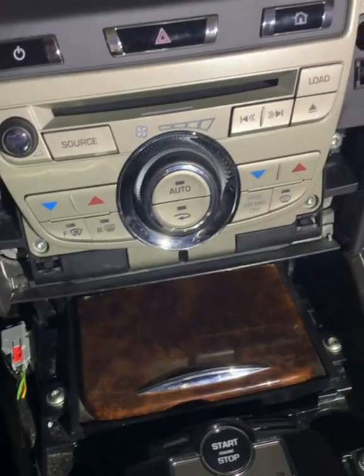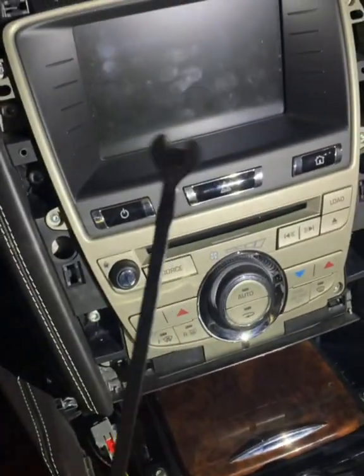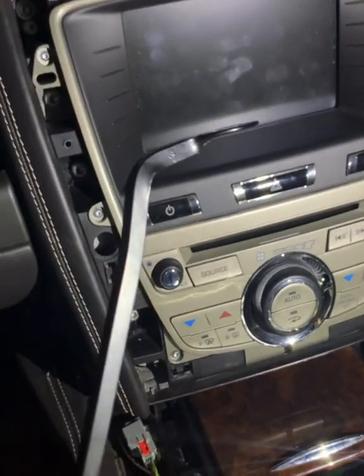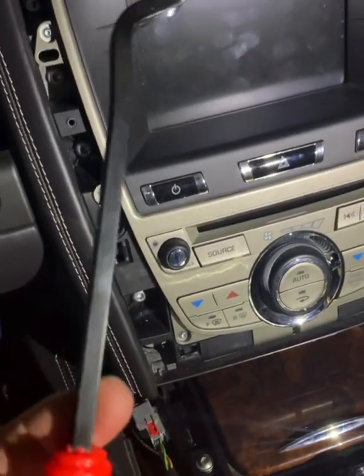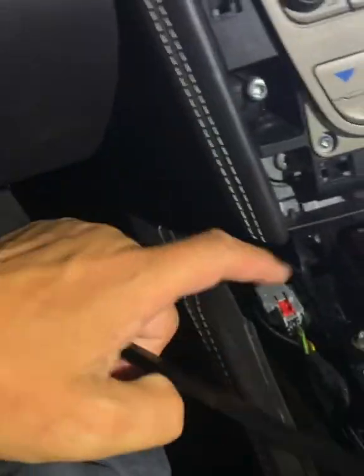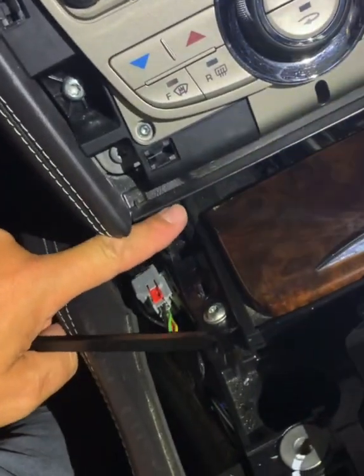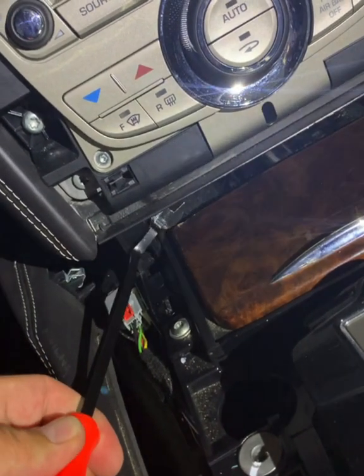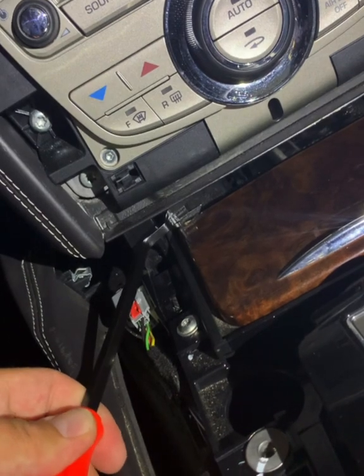And the only way I've managed to get it off, and it seems like a little bit crude, is to use a special tool, which is this here, which comes with a lot of the trim removal kits. It's like a little angled, it's a metal one. Most of the trim kit I've got has plastic pieces, but mine came with this little metal one. And then what you do, if you look into the back, you use this piece here as leverage. You put the tool against the back, and then you slide it down the back of the veneered piece.